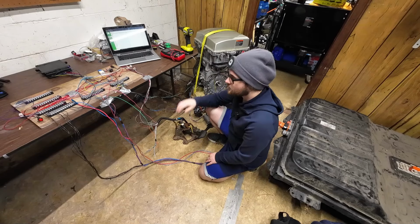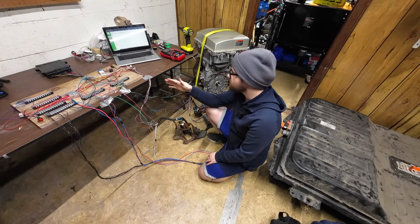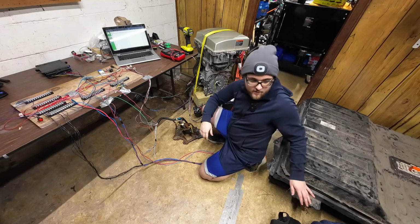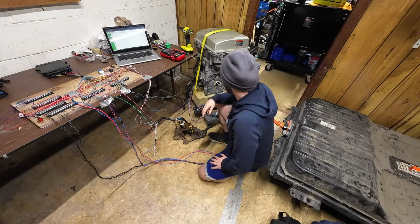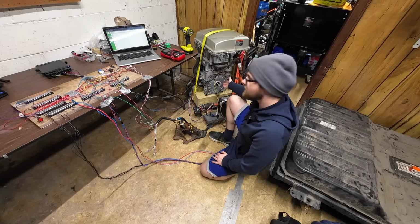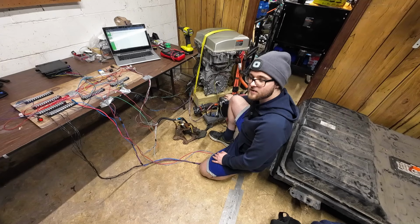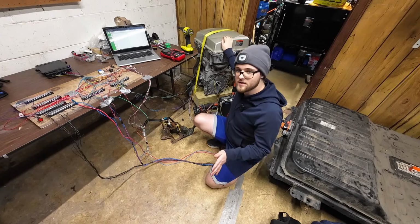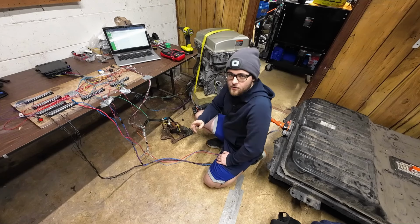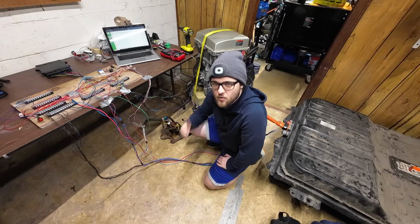So basically now that we have the wiring temporarily complete, the Zombieverter is communicating properly, the charger is connected to the battery and responding correctly, the contactors are opening at the right time, and we're getting enough communication to make the motor spin and the DC to DC charging from the charger to the 12 volt battery. That's the basics done. The next step would be getting the Leaf PDM charger connected to 110, 220. So either I'm going to do that in the next video, or I'm going to get impatient and do a bit of a side quest with this.